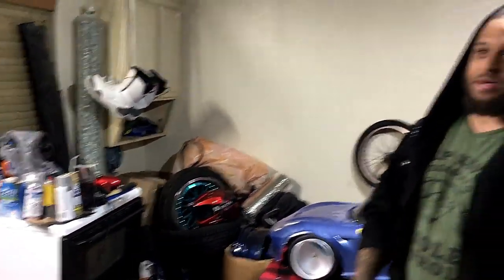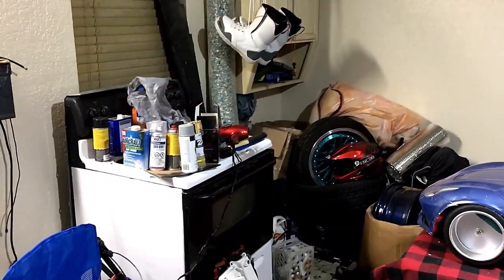If you're literally not going to do wheels, or anything chassis-wise, or big control arms and stuff like that, I'd say if you can find a Craigslist oven for about $50, knock them out, man. What I used to do with cake sheet pans, if you want to do bolts and stuff like that, is I'd drill through the cake pan. That way there's no powder on the threads, and then you can coat the top of them just like that. It's really easy to work with these ones. It's kind of hard with the bigger oven, but it's definitely doable, especially if you want to do wheels and stuff.